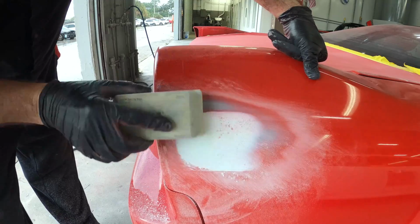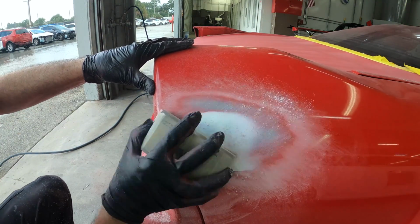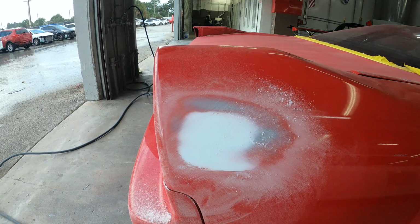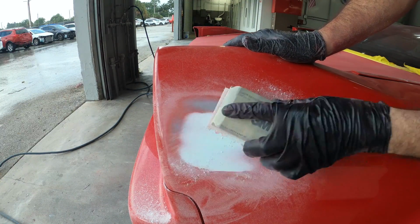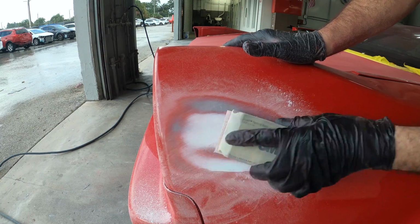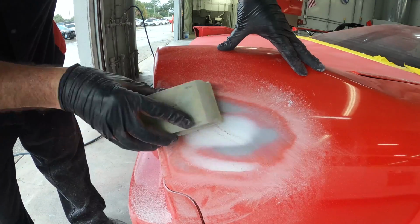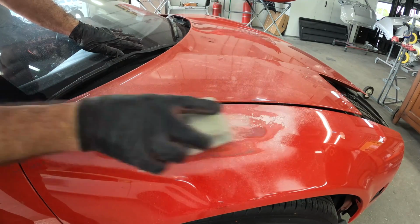Now, if you're doing real restoration work, or you have a larger dent, something of that sort where you did a lot of metal work, you're going to have it all sanded down to the metal. But for something just like this, you can go ahead and you can glaze it up, and make sure you're always blocking it out. Never take your DA right to your filler. Again, using that block, using the appropriate block to just scuff it up.